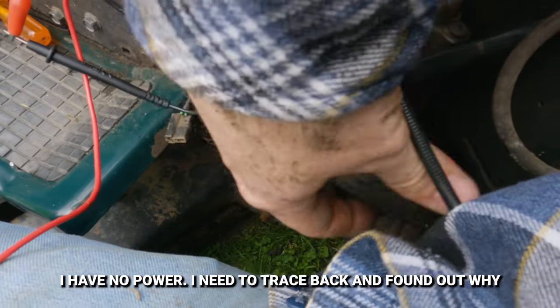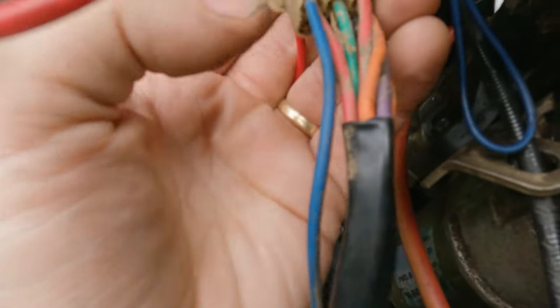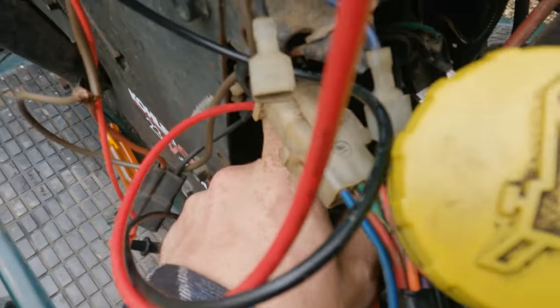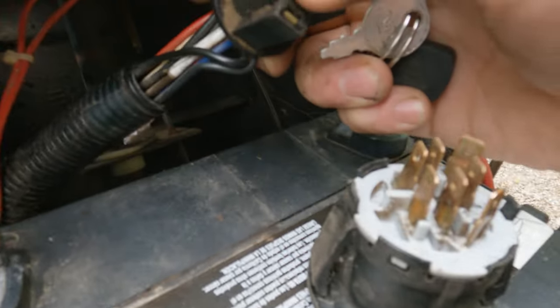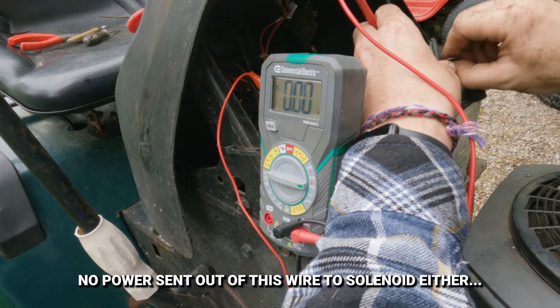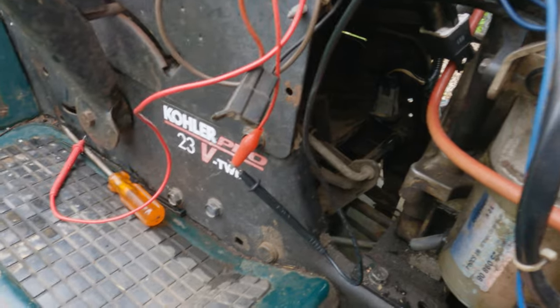Maybe it's not in. Following the solenoid wire, we got blue. Comes up in here to this top, from our perspective, top left. And then it turns to white, which goes back up to the switch. This one right here. Nothing. Nothing's from the switch when I turn it. So I just unhooked the PTO altogether here, which goes down to all those nasty wire nuts and everything that are just floating around down here. There's something going on. Pulling this out of the equation, seeing if maybe when we let out on a pedal on the other side, it does anything different.